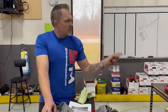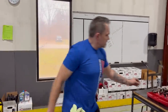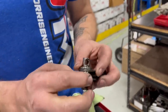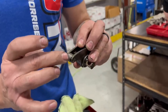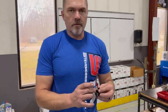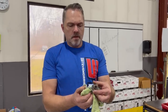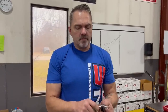I did have a question on the rocker arms, and I can't remember, I didn't know I actually used the Sportsman rocker. So these are a... See, that's a non-bearinged one. I'm not a super big fan of putting bearings on the end of the rocker arm tip. I kind of like them without. I think it makes a little bit stronger shaft and one less area for a bearing to fail. So I'd much rather have a bushing out there. I think the wheel is bigger on the ball bearing one. Obviously it's bearing in here. Our stuff that we use is bushing, bushing and bushing right up there.